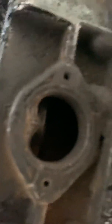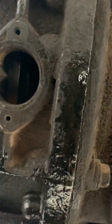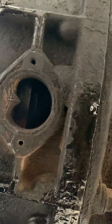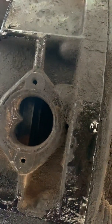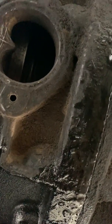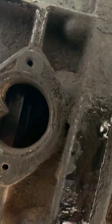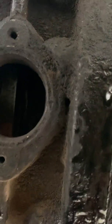Number one cylinder is sitting in the front, one through six in the back. If you look right here, there are markings. On that dial it says 'TO' and there's four dashes. I had to sandpaper it — it was all rusty, you couldn't see it. I reached up in these holes in the covers and found it. That says 'TO.' That is top dead center.